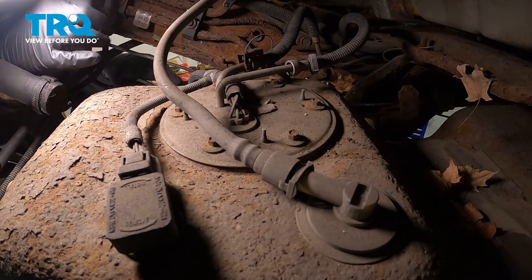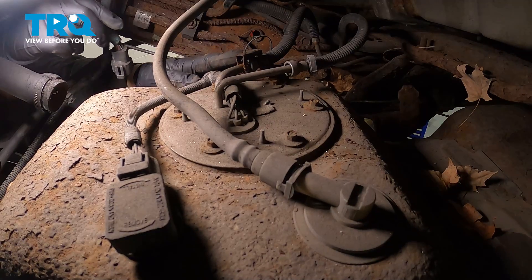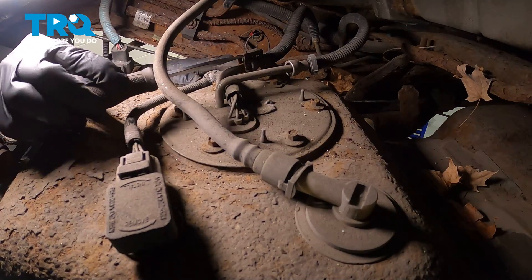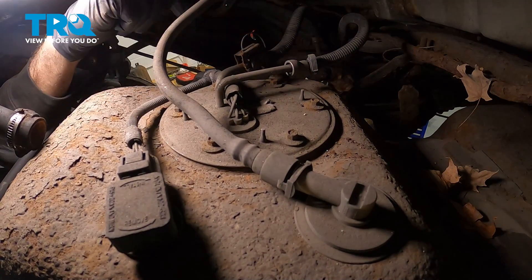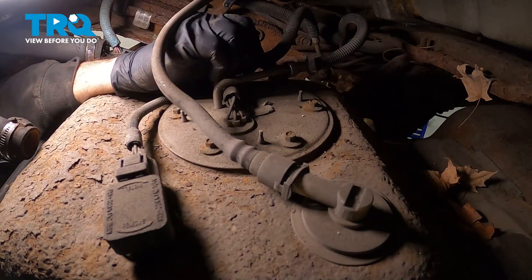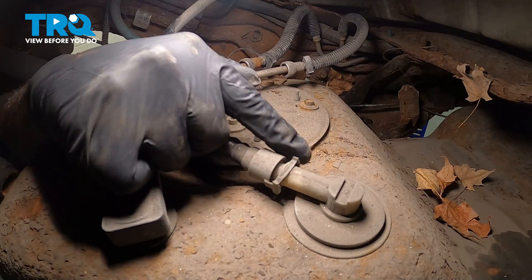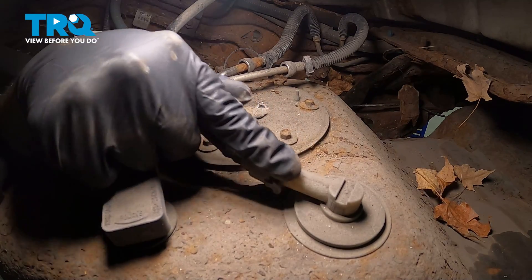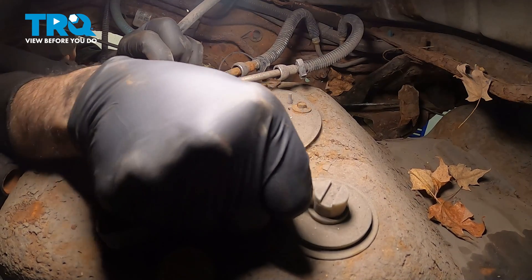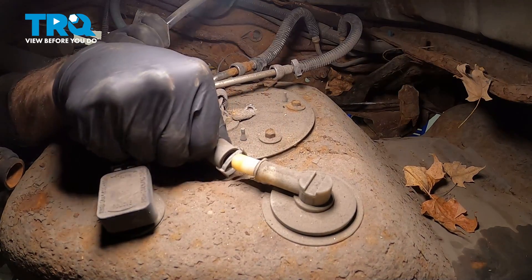Now that we have that disconnected, we're going to move over to our fuel line right here. There's a little metal retainer clip that assists in this line locking in. Using a flathead screwdriver, I'm going to lift up on the clip side on the external line connection — this is going to pry up. There's a locking clip, so we're going to pop that off. There's a line coming through with a little plastic locking collar — we're going to pinch these two sides, then push in and pull out, pushing in first to break some of the corrosion. Pop that off like that.